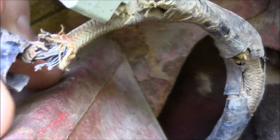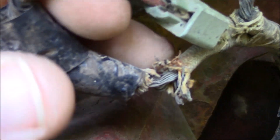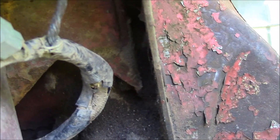As you can see this is some pretty old wire — it's got the cloth insulator on it, it's rotted, the wires are frayed, and it's been tapped into and reworked several times. You see a good bit of corrosion in there. It's just time for the wires to be replaced. We've got a large section here that's bare. So let's see if we can get all this out and start over.